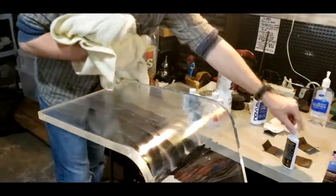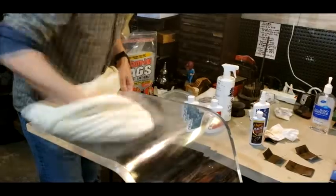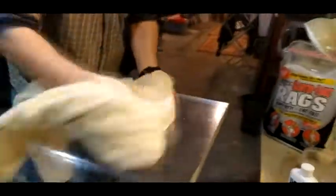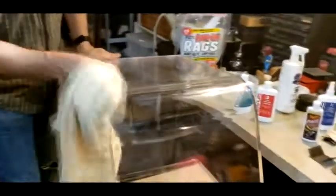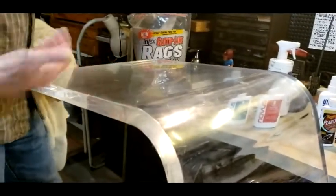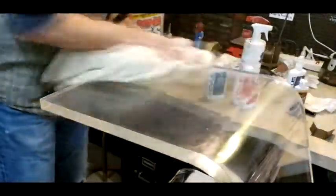Alright, so I'm wiping off the Meguiar's Plast-X Polish. This step I find is the most revealing and the closest it comes to being finished. It's almost a miracle — you just scratched up this whole thing with 400 grit sandpaper, and within the hour you are looking pretty clear. Now the reason this wouldn't look completely clear right now is because this other side is still really scratched up. The bottom was really bad because this scratched up across the floor bare, and also from people's shoes. Next we're doing this side, which should make this look best.